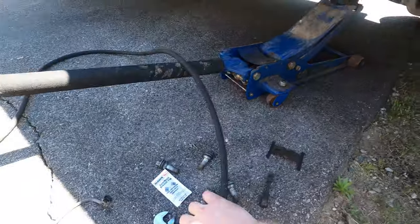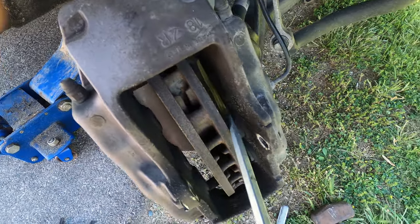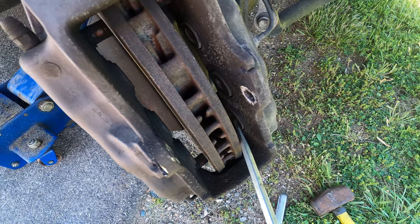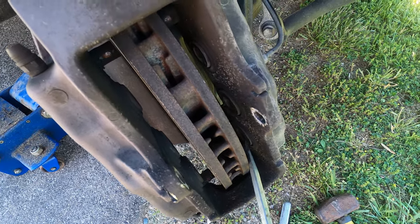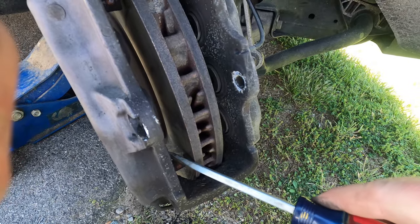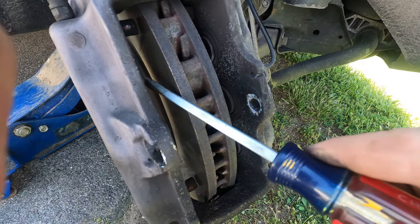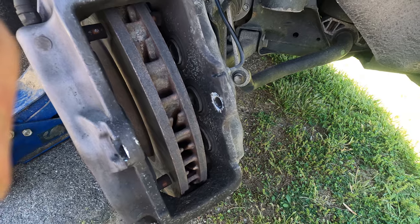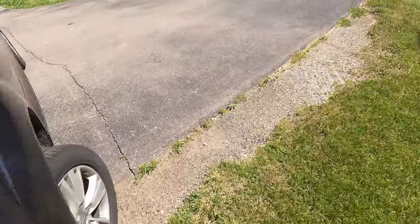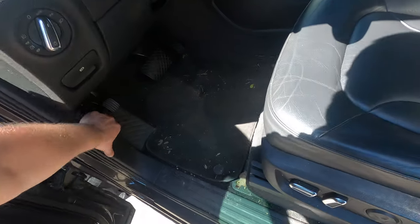I don't want to put something down in there, but off at the lip — oh, look how easy that is. It suffers the same problem as other multi-piston brake setups in that you push one in and another one comes out, but they generally don't come out as far as the other one went in. So if we want to do this the right way, we've got to get the hood up and get the cap off the reservoir to make sure it hasn't been topped off. Because what you don't want is to be pushing your pistons back in and then all of a sudden have fluid spraying all over the place.